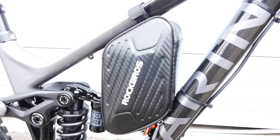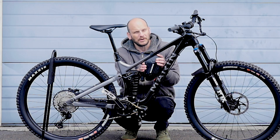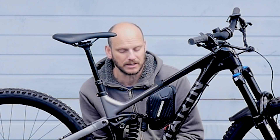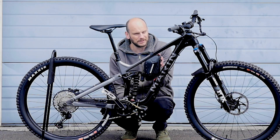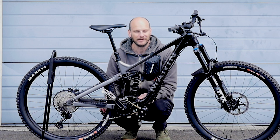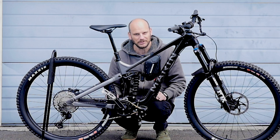Paired with this 52 volt, 8 amp hour battery, you get about 400 watt hours. If you're using 20 watt hours per mile like normal riding, that's about a 20 mile range. If you're going slower or using less power, you can get a 40 mile range. If you're using this thing like a dirt bike — using 40 to 50 watt hours per mile — you might get a 9 or 10 mile range. So obviously mileage varies greatly depending on how you're using it.